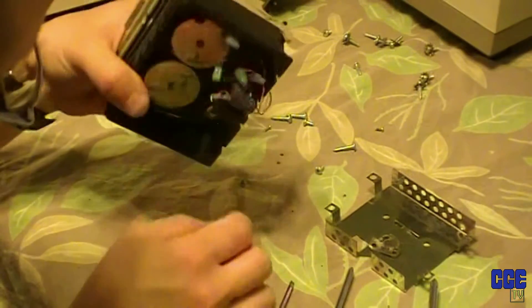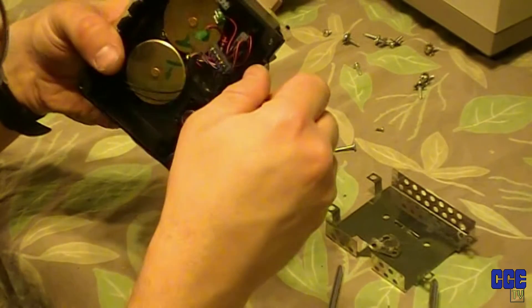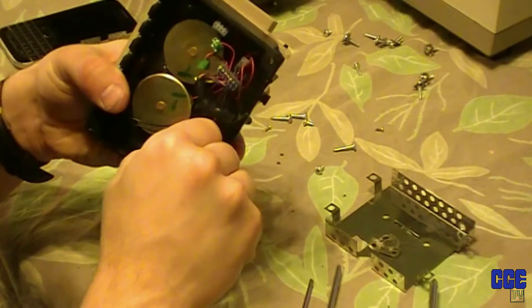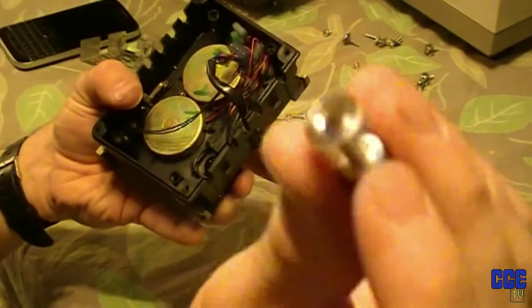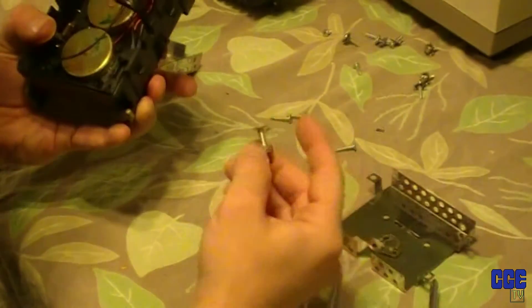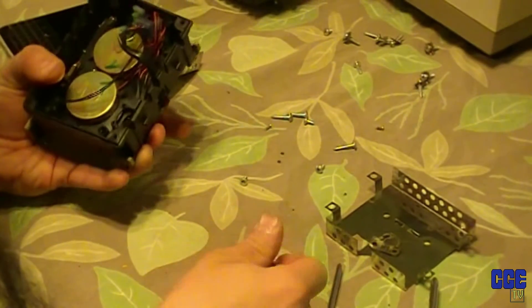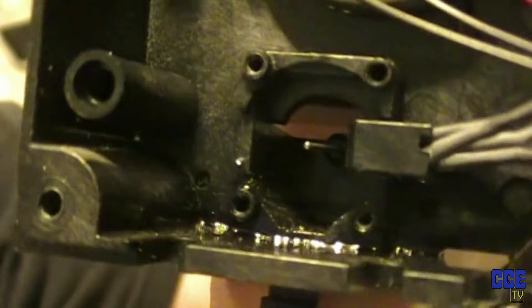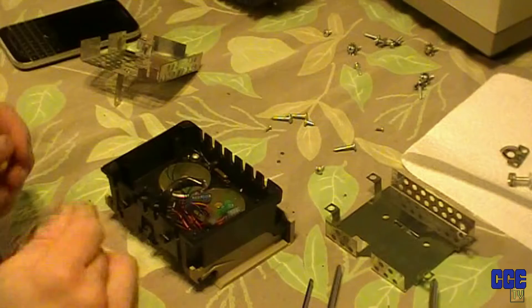The wheel should pop out, hopefully. Come on, stupid wheel. There we go, it's popping out. This is the roller — it's totally wrecked. It doesn't have the little holes in it that tell the Coleco Adam it's spinning. I'm getting goop all over my fingers. There's a whole bunch of goop in there that I need to clean out — that's why we have 99% isopropyl alcohol and Q-tips.